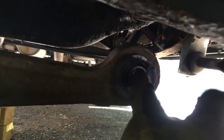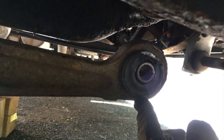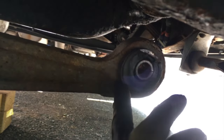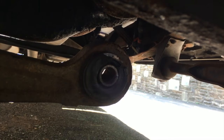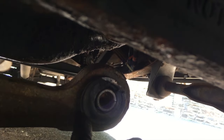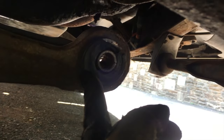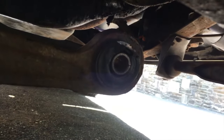I'm going to heat this up, push the inner sleeve out, then heat up the outer sleeve again and slowly pry out the rubber, leaving the metal sleeve there. If you were going with an OE-style rubber bushing again, you'd have to punch out that sleeve too — you can use a ball joint press for that. Since we're doing an Energy Suspension polyurethane bushing, we need to save that sleeve; all I have to do is get the rubber out.